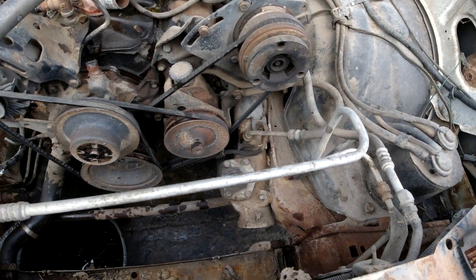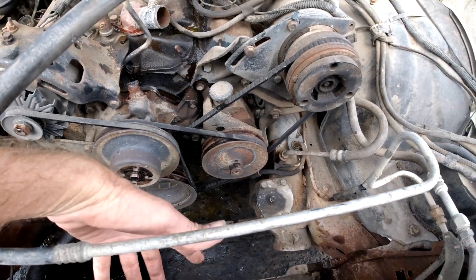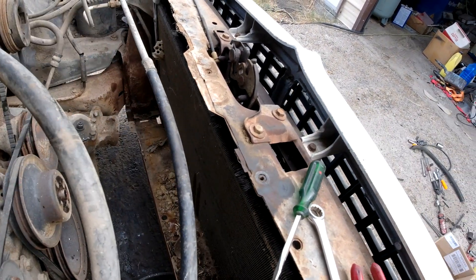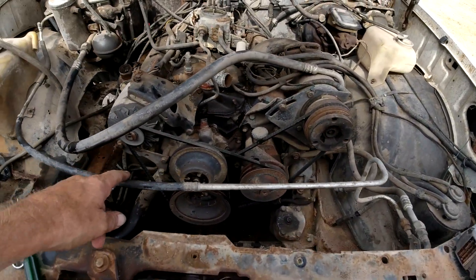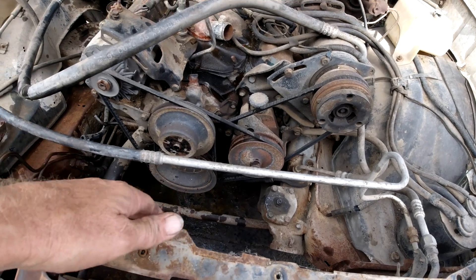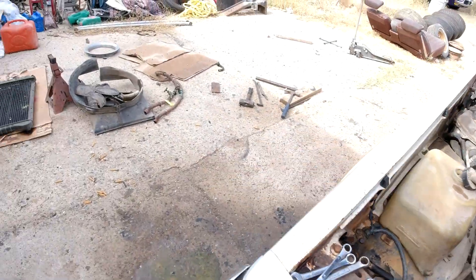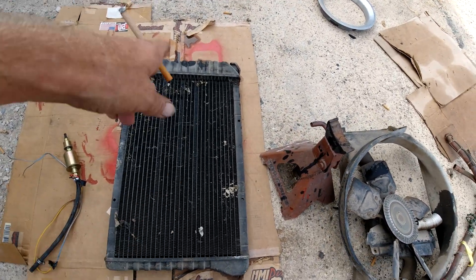Let me show you what I've got going so far. I've undone these four bolts and pulled the fan and the shroud at once — it's filthy. The car's just been sitting for 20 years, got all dirt daubers and crap. We're going to leave the AC condenser in there, but this hose here is probably going to be a problem — you're going to need every inch here to get the motor out. This harmonic balancer is going to be right here; we're probably going to have to unhook these hoses and push them over to the side.